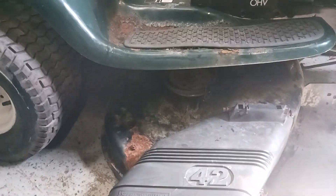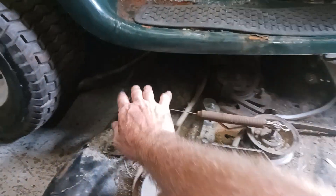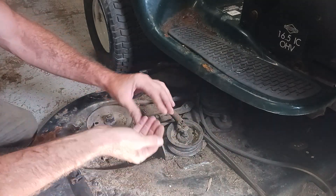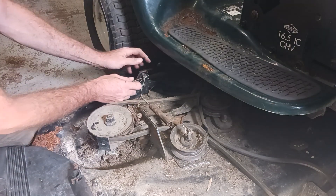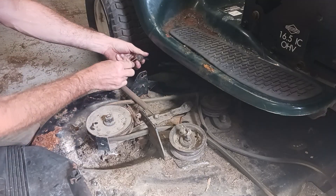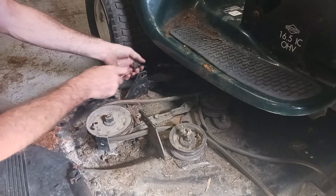Get your belt off and then we're going to come to the side where it shoots the grass out. We want to be careful — pull that deck out. As you can see there's a cable that's hooked; we don't want to mess that cable up, so let it come out just enough that you don't mess it up. Pull this pin off — there's a washer there. Just hold on to that and pull that off. The cable is still hooked to your mower deck, so pull your pin off, watch your hands, and that just comes out inside to that little shaft right there. Remember, this plastic piece is always on this side.